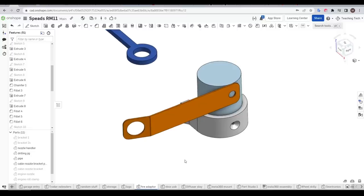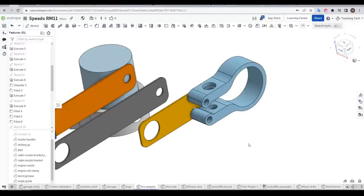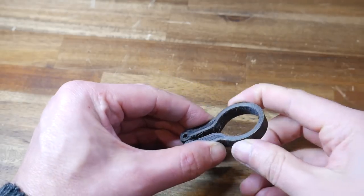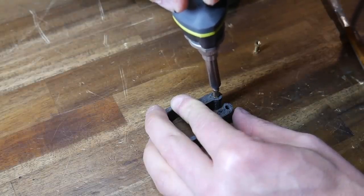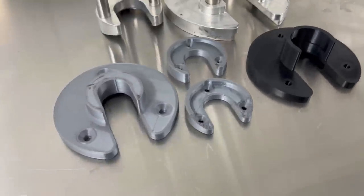The next part was a prototype bracket to hold the nozzles. These versions were just 3D printed, and it took three iterations before I was happy with the angle of the nozzle. There was no way I was drilling into the roll hoop support, so I designed a nylon bracket that would slip over the top and then have another aluminium mount bolted to it. I'm fully expecting people to tell me I shouldn't 3D print race car components — but the instructions state I can use nylon for mounting parts of the system, it's amazingly durable, and has plenty of thermal resistance for where it will be located. I know for a fact that professional motorsport teams 3D print components that live on the car, as well as 3D printing prototypes that later become metal parts.